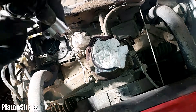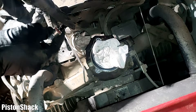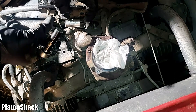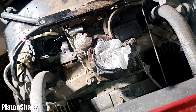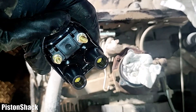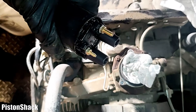All specs are on the condenser, and here is the new one. I'm going to put it on the same way as we removed it — installation is opposite to removal. Condenser is installed. Let's put that plate back and tighten all those bolts. Now we're going to put in the new coil. There's a screw to remove. Just remember the orientation of the coil and make sure it faces the proper direction — same as the old one.